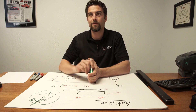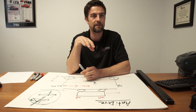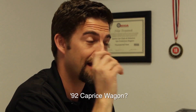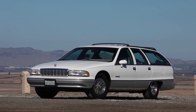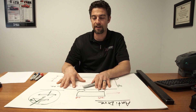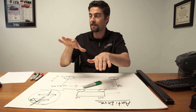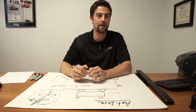If you've ever been in a really soft car — say a Ford Explorer or some SUV — try this: at a stop sign or stoplight when you're bored, power brake it but don't spin the tires and see what happens. Even though the car does not roll, the back end is going to compress, and that tells you that it doesn't have a lot of anti-squat.